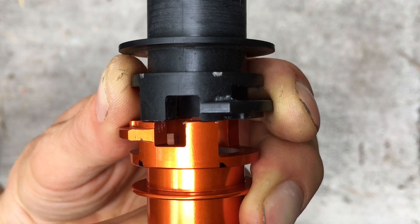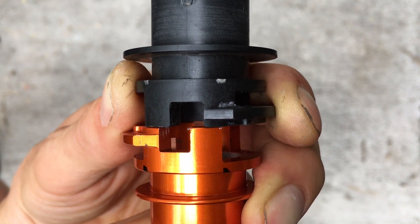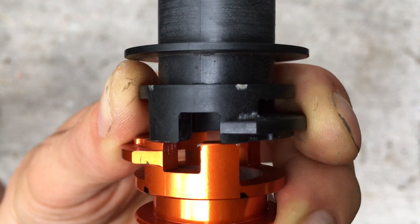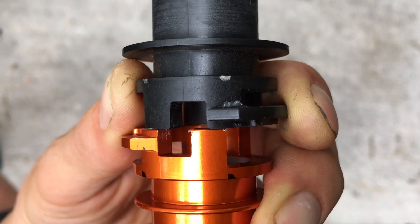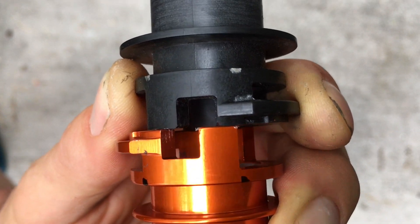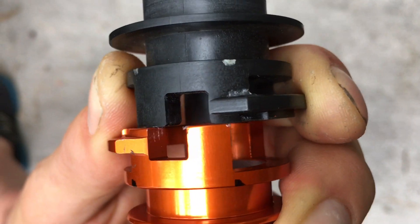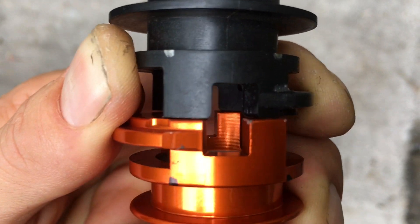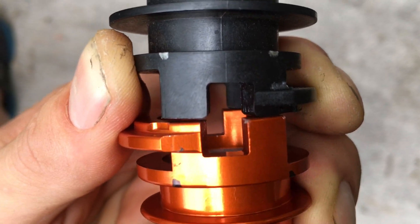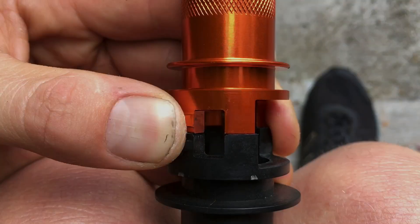Just so you can see with your own eyes — this throttle does not change the amount of turn. It's not a quarter-turn throttle or anything like that; it's the exact same throw. By marking where the original throttle and the G2 turn, you can see the silver mark on the black throttle and the black mark on the orange throttle are lined up in the same exact positions. The cuts are in the same place, so it does not change the throw of the throttle — that would probably have to be done electronically within the ECU.